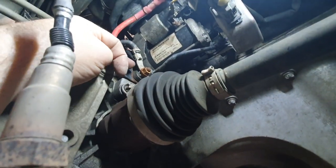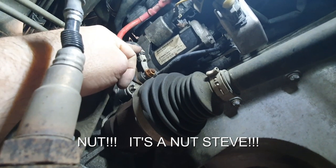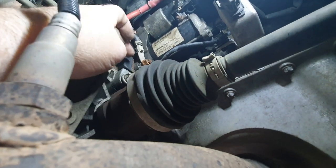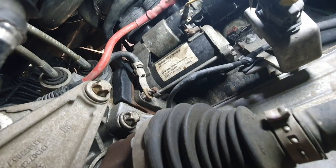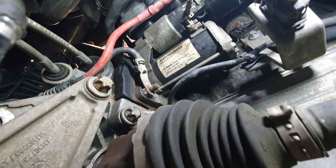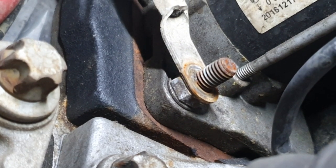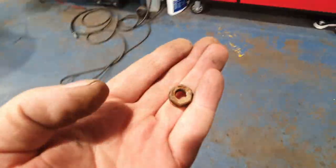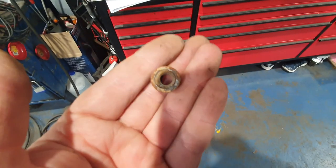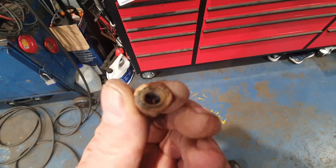Back up in the air now and I'm going to take off that rusty 13mm headed bolt — that's the earth cable from the point underneath the battery. Have a good look at it, make sure it's clean, give it a clean-up if there's any pitting or corrosion, then build it back up. I've got the nut off — let's just zoom in — it is quite rusty and chances are this is our issue. In my hand, that is the business end of the nut itself — very rusty.